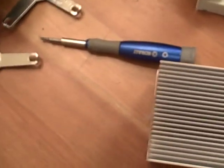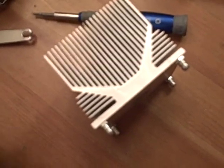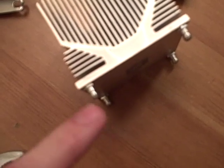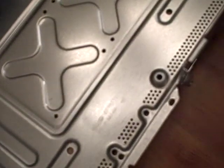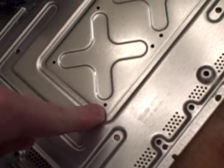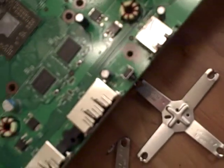I found the thing online about improving the heat sink design as far as how it mounts. So there's a parts list. Basically what you're doing is you're removing these, putting a bolt or a screw through - actually drilling these holes out bigger. The screw is going to come in from the bottom up, there will be about four washers, then the motherboard, then a washer, and then it will go into the heat sink.